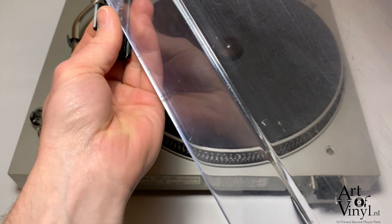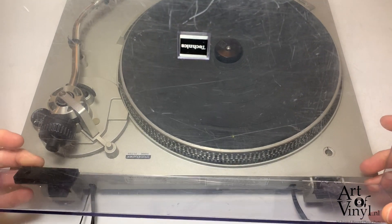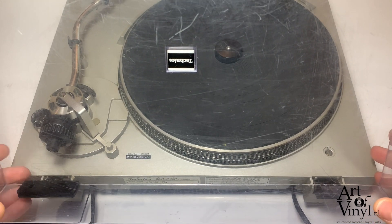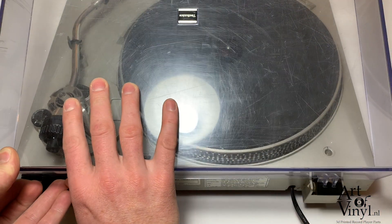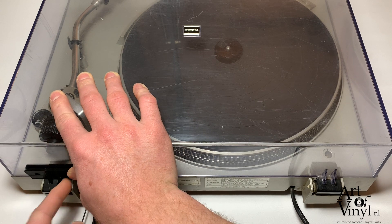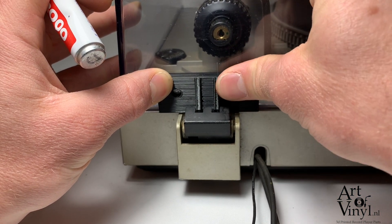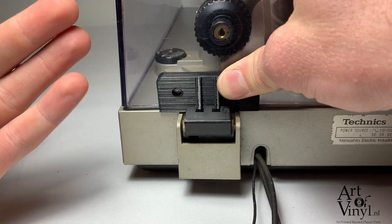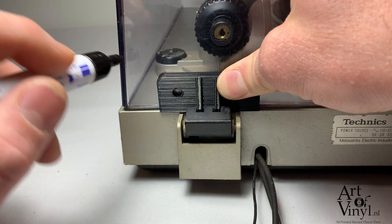What we'll need in this final step is to fit the hinge again and put it in position on the record player. While you're doing this, please keep supporting the dust cover so the weight of the dust cover doesn't fall fully on the hinge when you close it — like this. I keep my fingers under here and use my other hand to gradually close it while I keep supporting it. The lateral forces of the hinge wanting to pull the dust cover back are able to damage your hinge, so please be very careful here.